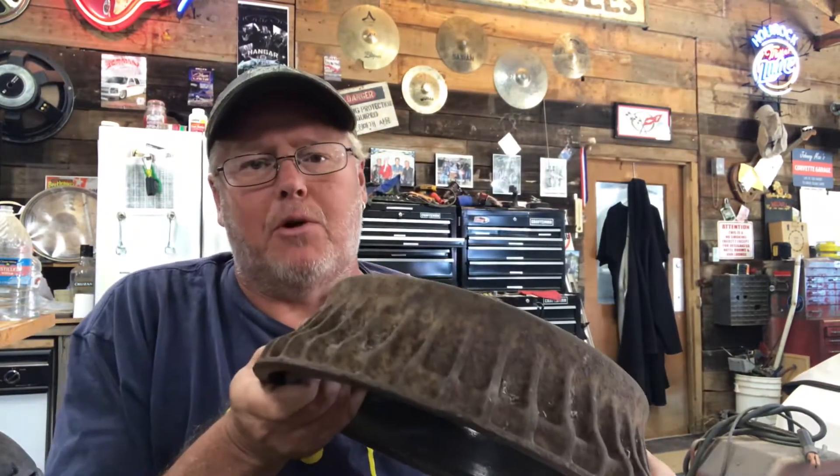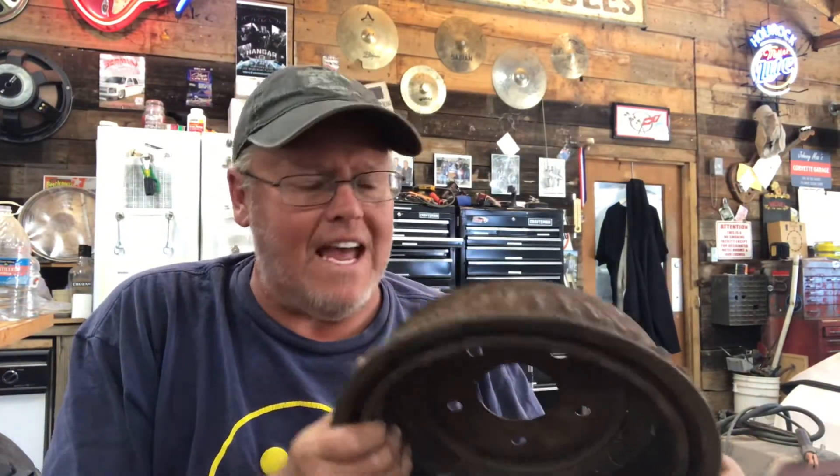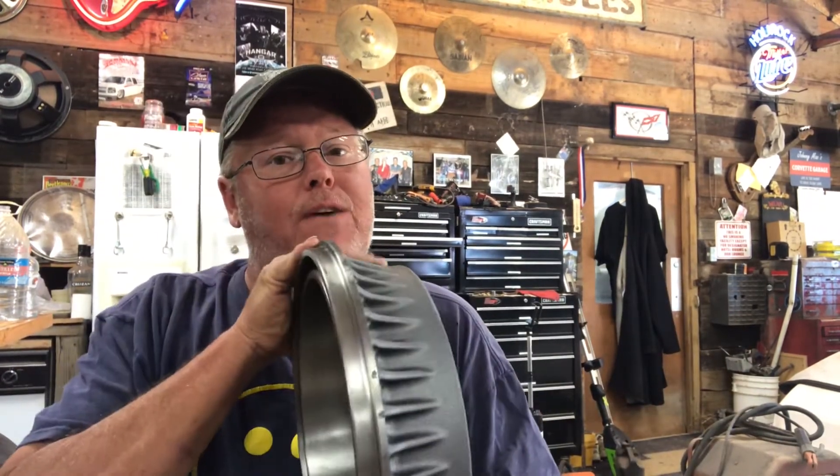I had planned on just doing a short clip about the brake drums, but the S10tacious channel dropped a video about year model identification using interior mount points for the door handle location, and that sparked me to do a more in-depth video. From 1982 to 1990, this is the brake drum GM used on the rear of the S10 series. In 91, some had that same brake drum and some had the newer version with the lip on the edge. In 92, all of them were the newer style.